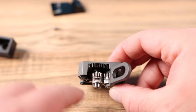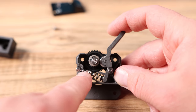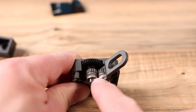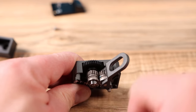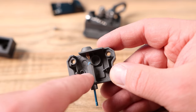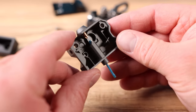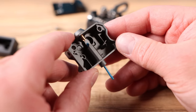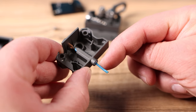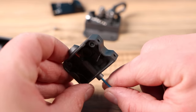Let's take a quick look at the gears. It is a dual gear drive — this is where your filament travels through. This is the knob to turn everything on the outside and here's your tension spring. You pull this down and it allows it to go through the channel. Through the channel it hits those gears and pushes down, and it appears that my filament — which is blue — is jammed and stuck right here. At first glance I thought this was a PTFE tube, but you can see where the extruder put grooves in the filament as it was pushing it through. I'm going to pull that out with pliers.